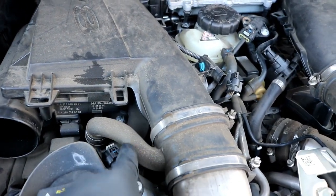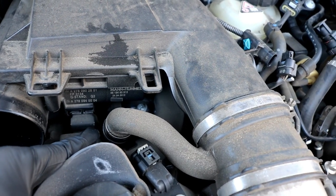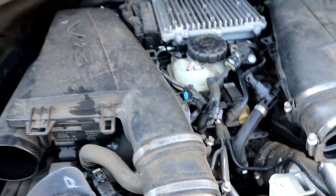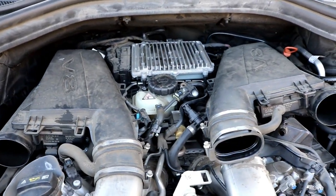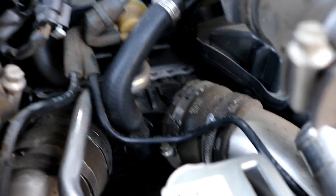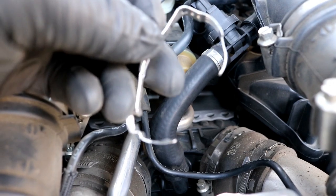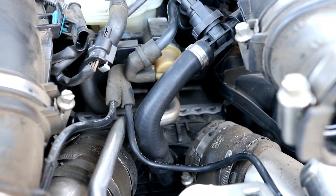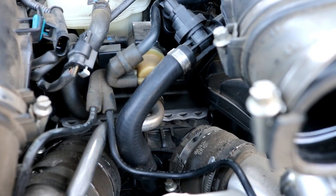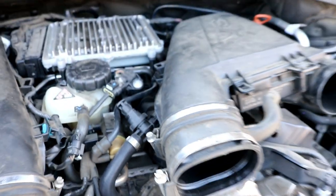On this side you'll have the same type of situation — a hose that goes down into the valve cover. I do not recommend trying to take that one off, as you might crack or break something. Instead, just remove this housing from the rubber connector and everything else — you'll find it comes right out without any issues. The method I chose was to break off that hose clamp by bending it a little bit, then I'll just replace it with a regular screw-type hose clamp. Now I can pull that hose off the breather and remove this whole thing as a unit.